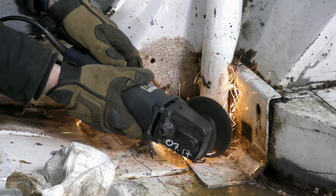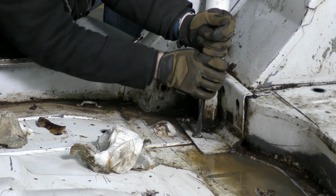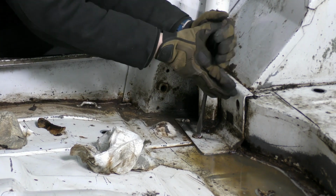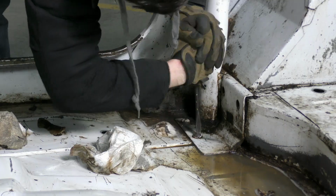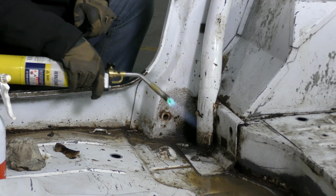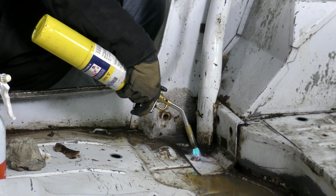There were a few sticky bolts on this tub, so while I was working on the firewall ones, I had French Mike working on the main hoop bolts, and they turned out to be quite a bit more stuck, but it was a good learning experience for him to see how I like to remove them and go through the entire process. The only real change that we made was he was also hitting it with a hammer in order to get the penetrating lubricant into the threads and try to break that loose as much as possible. In the end, it really didn't work out.